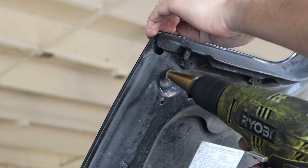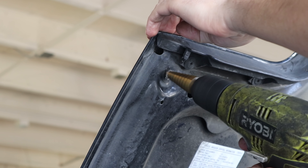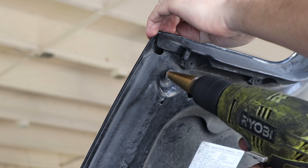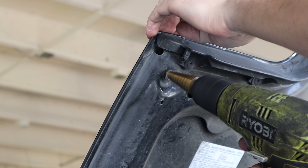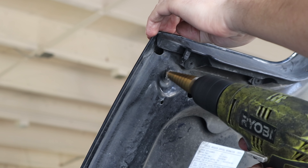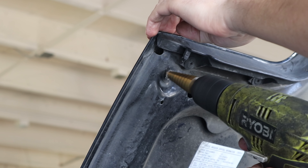For the sake of simplicity, I got a new Eibach spring by just measuring the inner diameter and getting a matching spring. For some reason these are only two-inch shocks yet they're running a three-inch ID spring — kind of crazy how big a spring they run. Straight off memory, the main spring on a Razor front is around 280 pounds, and the new springs I got have a spring rate of 600 pounds — basically twice as stiff. You can also find notes on all the springs online, showing compressed length and extended length.